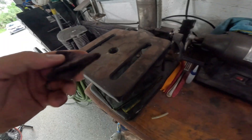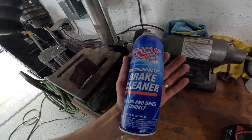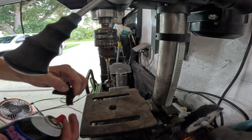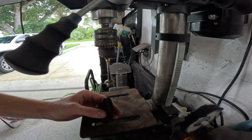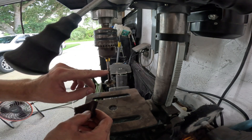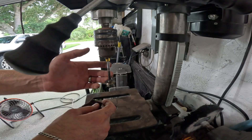So the next step is you take a Scotch-Brite — this is a red one, I usually use it for paint and whatnot — and some brake cleaner. You could use a valve cleaner, which might be a little better. Spray some on the Scotch-Brite, then as it's spinning you just put pressure where you need to and you'll see the valve cleaning up over time. It's not going to remove metal — it's just going to clean up the carbon. Try not to go all the way up the stem; stay in the area where you're cleaning the carbon off.